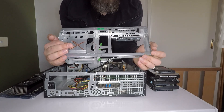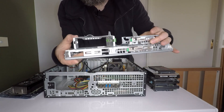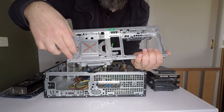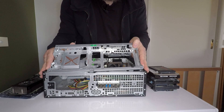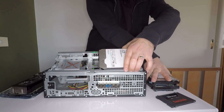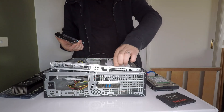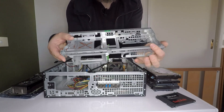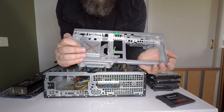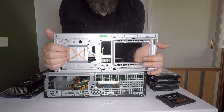Up the top you can see I've marked out what I'm planning to do: we're going to have a hard drive here, the SSD sitting under here, another hard drive back here, and then up the top where the optical drive was I'm going to have to do a bit of case modification to flatten that area out. Then we're going to have one hard drive sitting up the top here and another one sitting up top as well, which will leave just enough room for the power supply cable and the SATA cable. I'll mostly be using tin snips, but a Dremel with a metal cutting bit would also work.